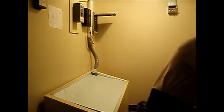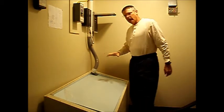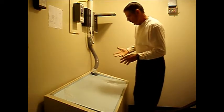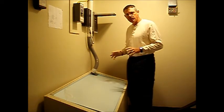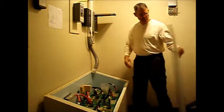You should water your batteries late in the evening, several hours after a charge cycle has ended, or early in the morning before a new charge cycle begins. I like to water them early in the morning because it suits my schedule a little better.